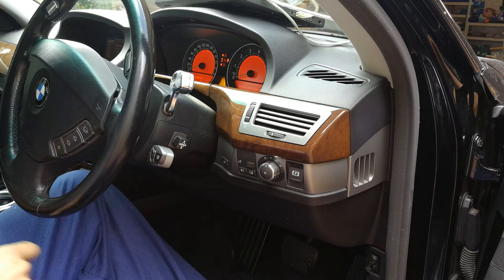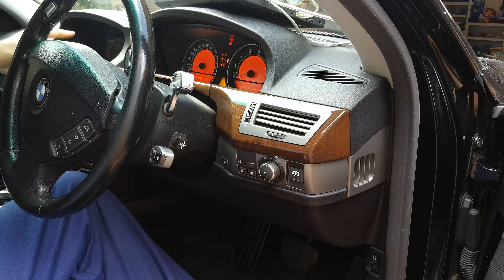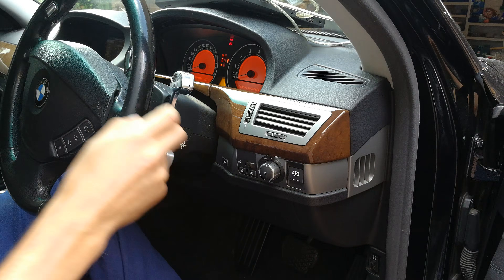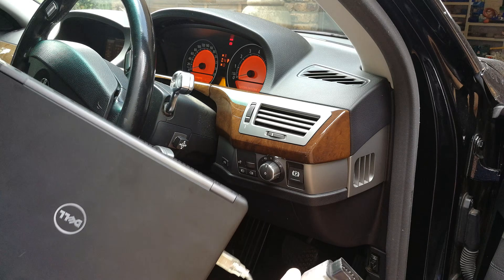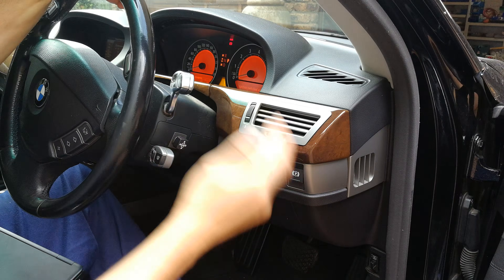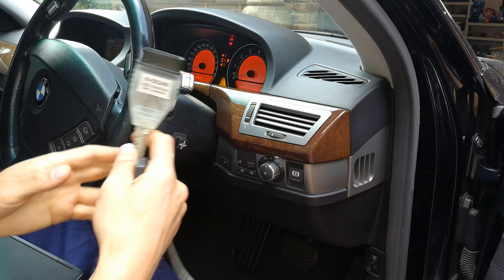Some things to note: when I did the repair it would not clear the error — you'd still see the yellow warning sign on the dashboard, and on the OBD it came up with 'parking brake fault'. Even pressing the button three times did not solve it. I checked the fuses and checked my installation, but I unfortunately had to connect my laptop and use it to clear all the errors. As soon as I cleared the errors, it worked. You might find the same — if you need to know how to clear the errors, I have a video on my channel that clearly describes how to do that.